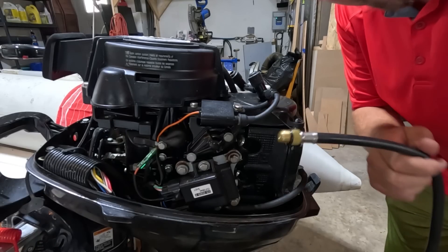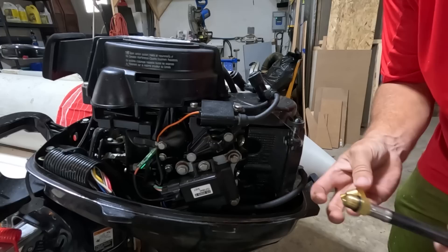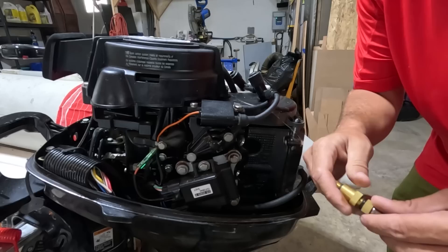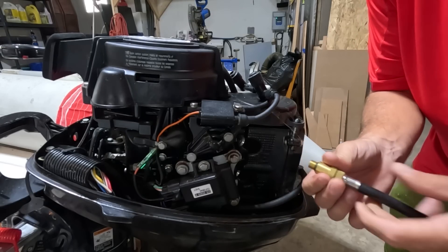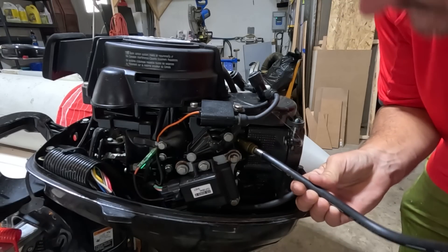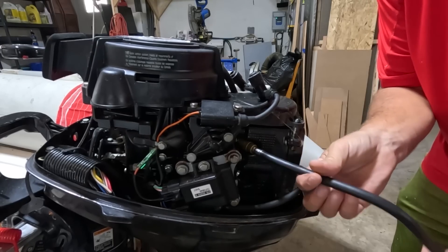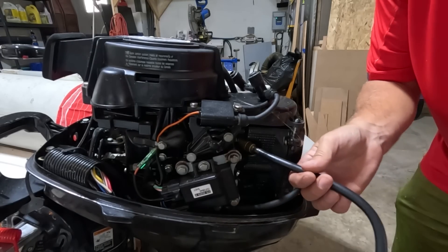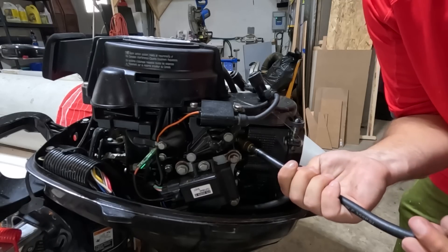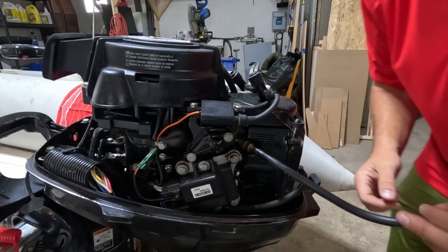As Phil said, we're going to thread in the hose that comes with the compression tester, but the direct fitting is too big for this spark plug hole, so we're trying an adapter first to find the right one. We want to be very careful not to cross-thread it or have it go in at an angle. That one feels like the right size. We spin the hose gently — we definitely have a bite there. We spin it down to the rubber gasket on the fitting, just finger tight. That feels really good; we should have a good seat on the rubber gasket.